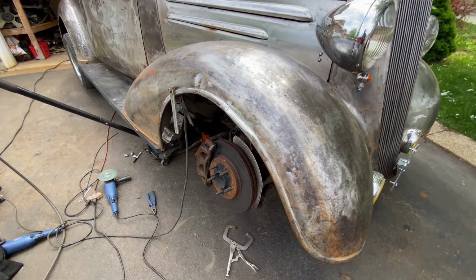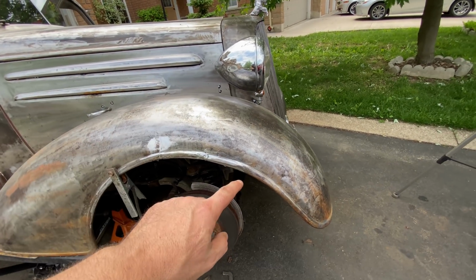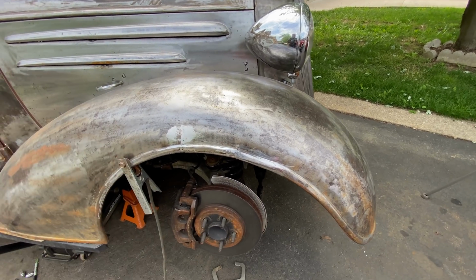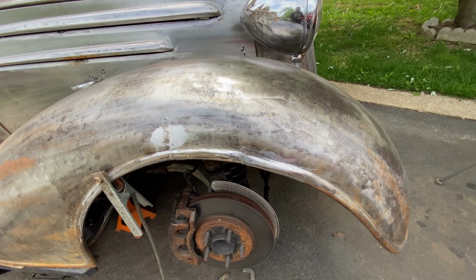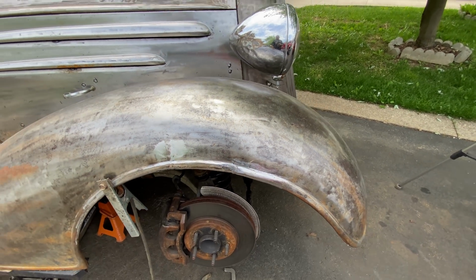You know, they say if you're not good at welding, you better be good at grinding. I'm kind of mediocre at both. I'd like to see how it turned out. It's like I was never there. Okay, I have welded, ground, welded, ground, welded, ground. The metal's just so thin. Every time you grind just a tiny bit too far, you're getting little pinholes.